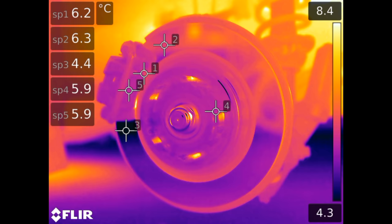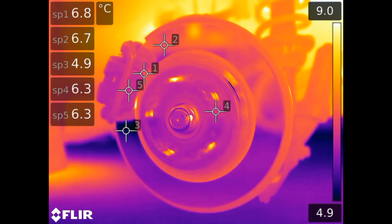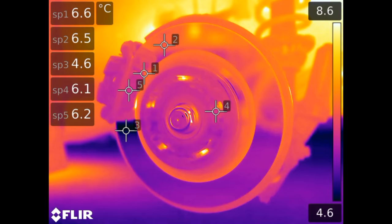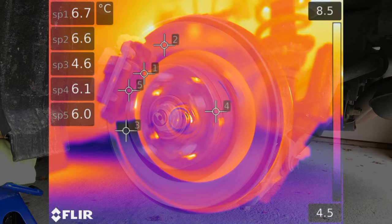Eventually I'll be pulling the handbrake, but to start off you can see that as the brake disc rotates, a portion of it is slightly hotter than the rest. It's important to note that this camera is extremely sensitive to temperature variations, so even a slightly warped rotor or a rotor with just slightly varying thickness will easily show up based on the temperature differential. I can't feel any vibration from the rotor while driving, but it's cool to see that this is something you can visualize with a thermal camera.